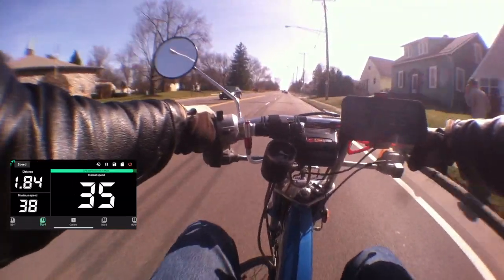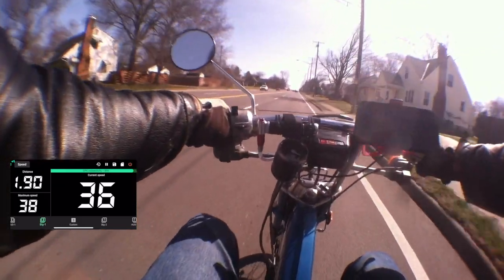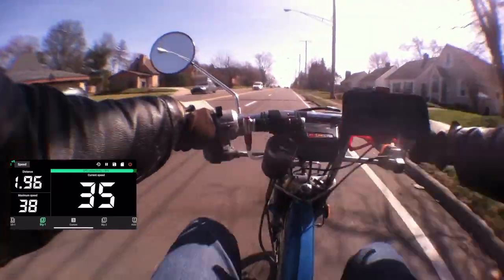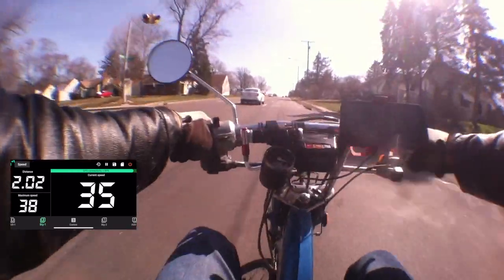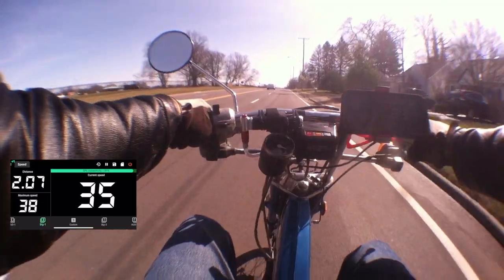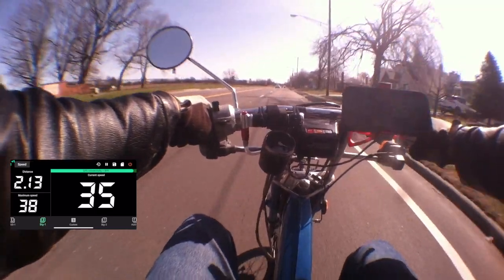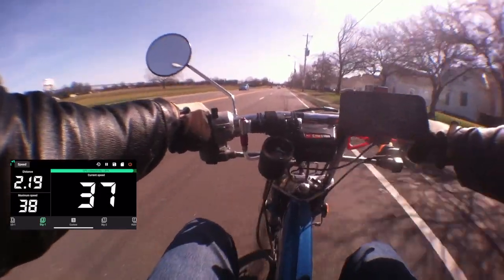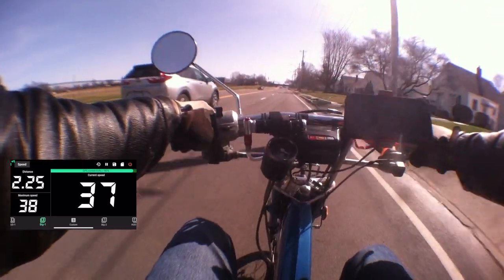No, thank you. And so I was going to install it, and I was like, oops, I switched the intake so I could run this Mikuni VM20 carburetor. So I had to go to plan B, which was non-existent at the time, but we made one up on the spot. Turns out this airbox thing I bought has a brass inlet opening that worked perfectly with the brass connector that came with this kit. So I just did that, and I ran the line.